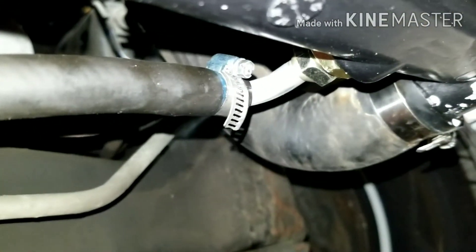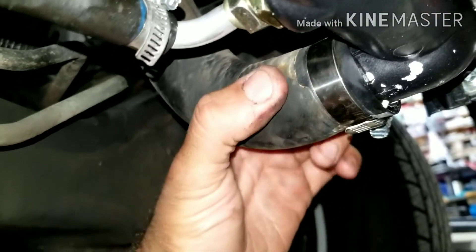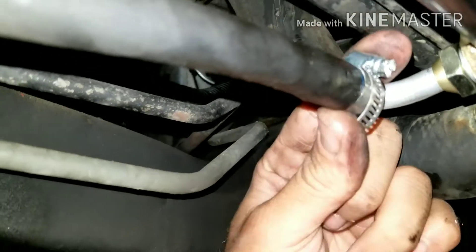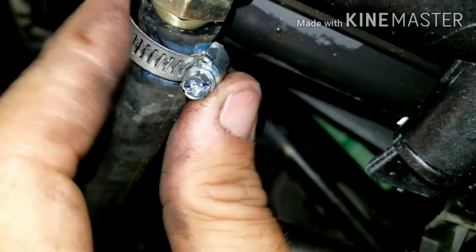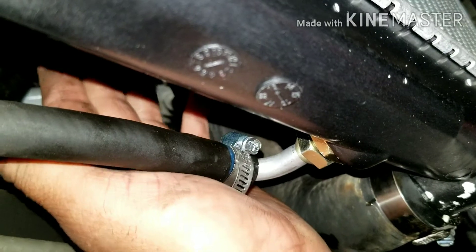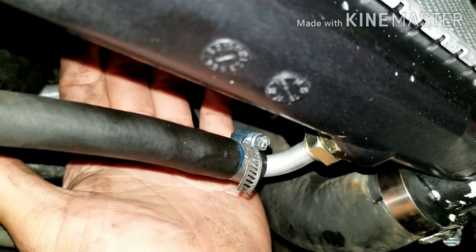I'm underneath here. I've already put my hose clamp on. You want to make sure it's quite a ways behind where it's beveled out — right here is great. My bevel's up here, my hose clamp is here — not at the end, but just a little ways back. You always want to put new clamps on here. You don't want to reuse those spring clamps. Spring clamps, once you detent them, they lose their tensile strength, which means their clamping force isn't what it used to be. So you don't want to trust that with your brand new radiator or your engine.